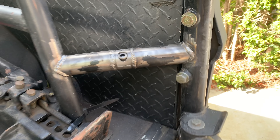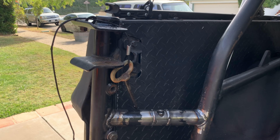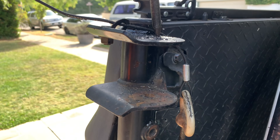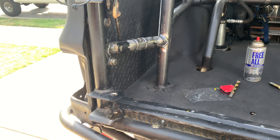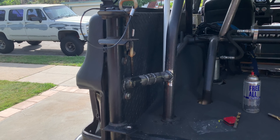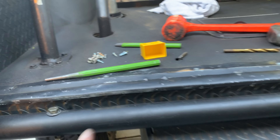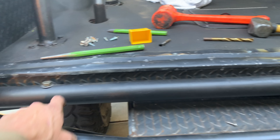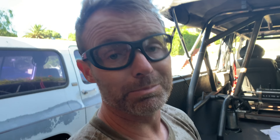We got both of them in. It's still tight to close — that's always been my biggest challenge, getting these things to line up absolutely perfectly. I've widened these holes a little bit. It's definitely us just doing more and more to lock down the frame, the body, and the cage all together. What I'm going to do today is get this backing plate — right now it's just kind of stuffed in there — and get that bolted to the body as another point of tying things down.